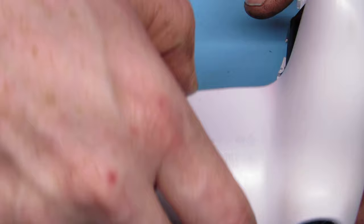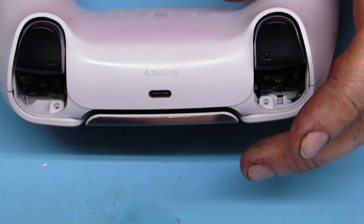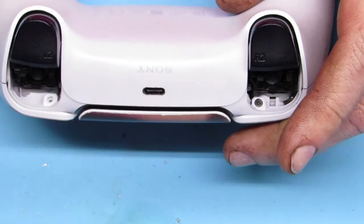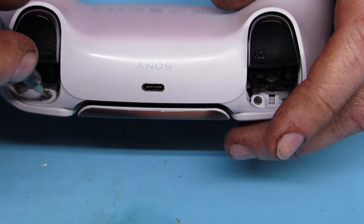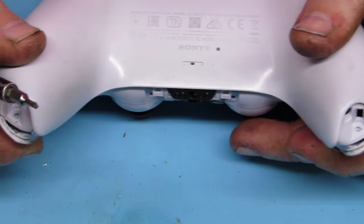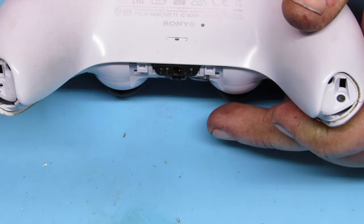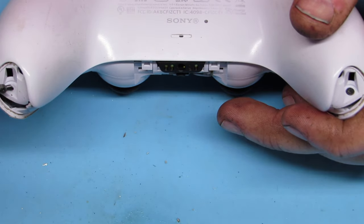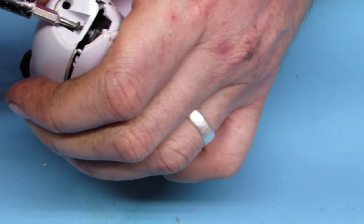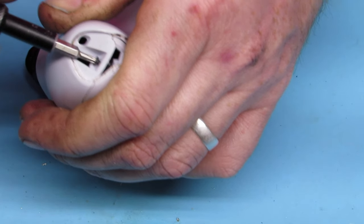Then we take our back cover and put it over the top first, over the top buttons, and then squeeze it on down. Two screws on top, just as we took them out, going under the L1 and R1 buttons that we'd taken out as well. And our last two screws go on the bottom of the controller itself. Make sure the controller is actually mated and in the right position, otherwise you'll screw into air and it won't do anything — and you'll look foolish on the internet.